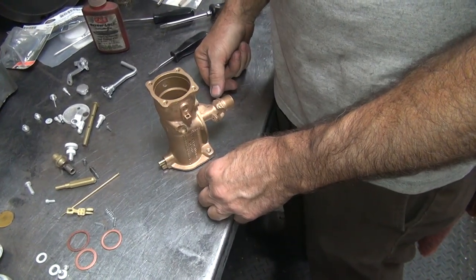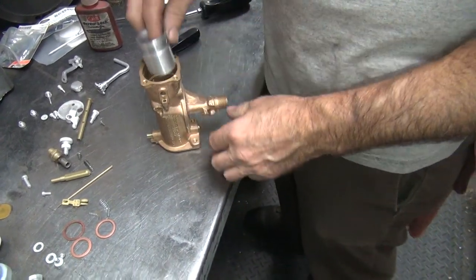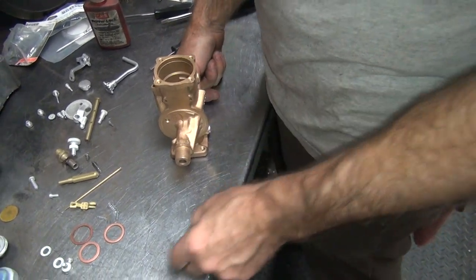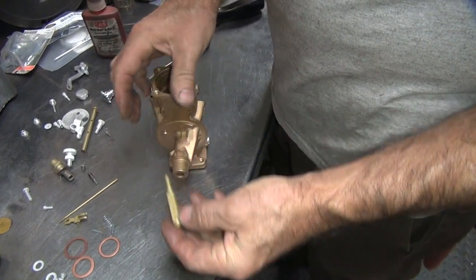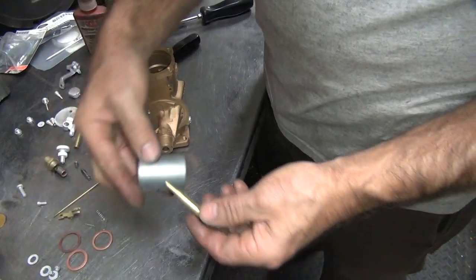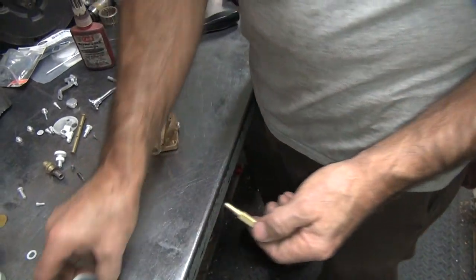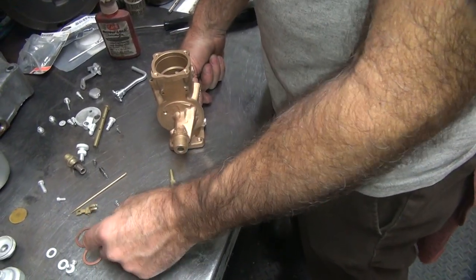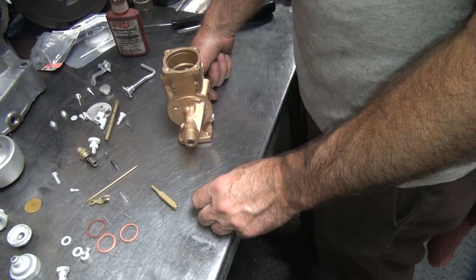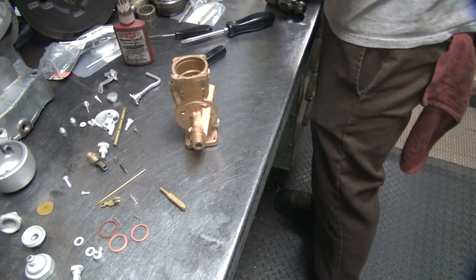Choke — more parts. Even if you're choking, you've got to put this in before you put the choke in. It goes in there like that — it's just a little bit harder to do. There's your spray nozzle. It goes through the venturi, like that. That's what holds it in. Where's your big spring? Those are the springs I had — big springs in this thing.